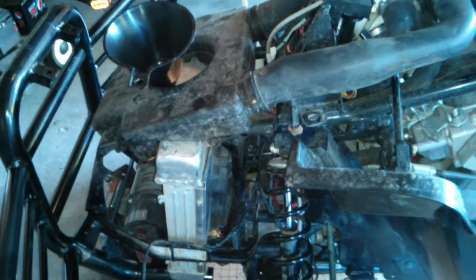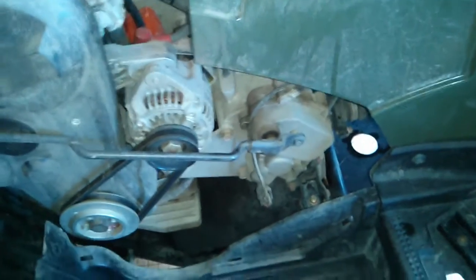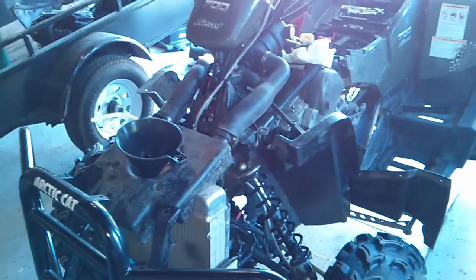As far as I know, this should fix it. Also, some people suggested me not to do this, but I'm going to do it anyways. I've decided to take off my temperature sensor and directly hook up the power to the fan, so every time I start the machine the fan is on — no matter what. Some people say that may not be good because you may run out of power. I have it on a trickle charger every night, the proper one that doesn't overcook it. But not only that, this is a 40-amp alternator — and because it's so high in output, I have a strong feeling this is more than enough to keep up charging for the fan. The fan shouldn't draw that insane an amount of power. Also, I usually don't use my headlights on, so I think with the combination it will be good to keep the fan on all the time. It will keep it a little extra cool and hopefully help prevent any further issues down the road.